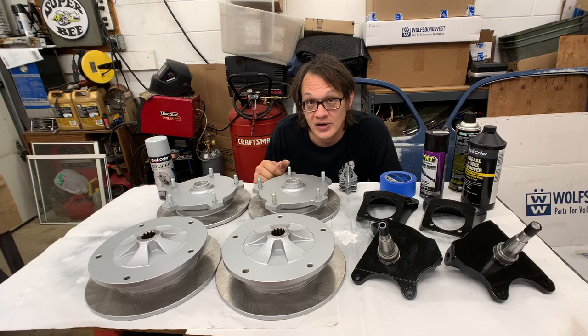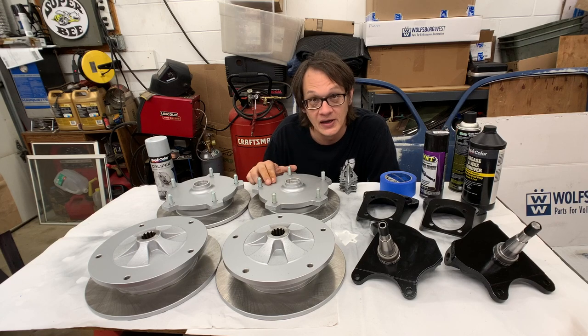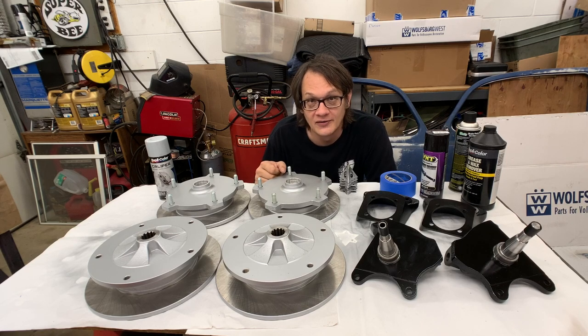If you have to repaint it or touch up or anything like that, again, follow the instructions on the can that you're using. If you end up spraying too soon on a surface that's not ready, you could actually wrinkle up the paint and hurt the finish. So I can't stress it enough, just follow the instructions. Remember, those guys are a lot smarter than we are.